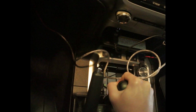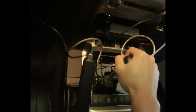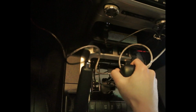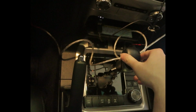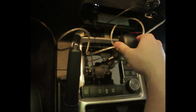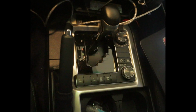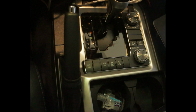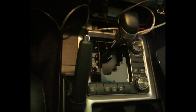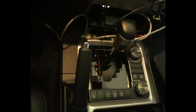turn off the engine. Now we need to repeat the entire process, from draining to refilling to running the vehicle, 2 to 3 times. Here, I recommend you do it a total of 3 times in order to let the old fluid fully cycle out from the transmission and the new fluid fully cycle in.